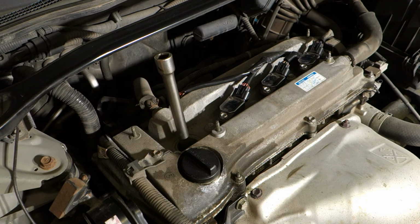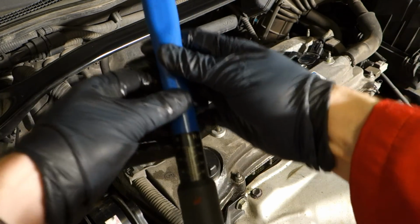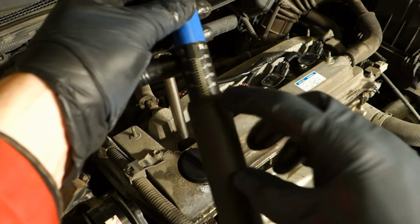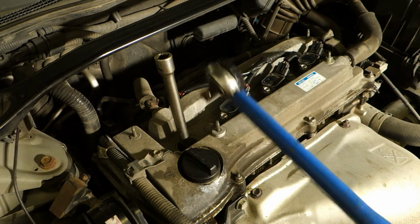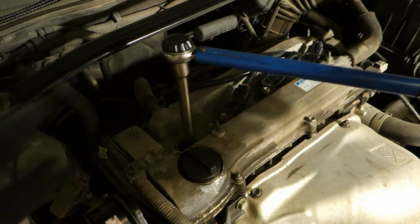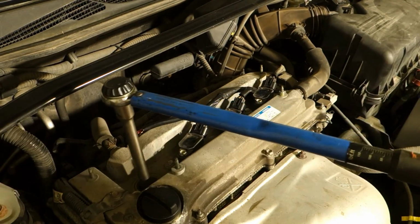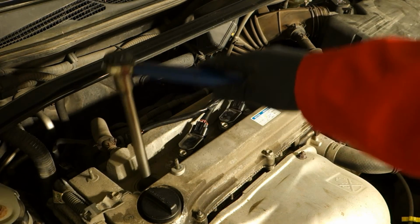is to use this torque wrench tool, and I take my tool and adjust it for my spark plug, and here we need only this force. It is 20. Look at the Newton meter amount in here. There is 20, 20 Newton meters, and I rotate, and this lowest point is 20 and a little bit more, and now there is about 20. Good. And then I adjust my tool in that place, and then I need to move it only a little bit, and when we hear this click, okay, it was right away. This system says click, and now it means that there is 20 Newton meters in this spark plug, and it is enough. And then I take my tool away,